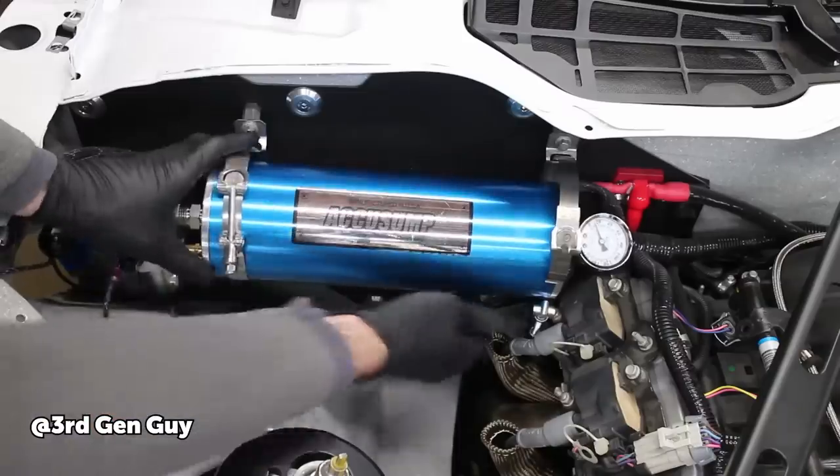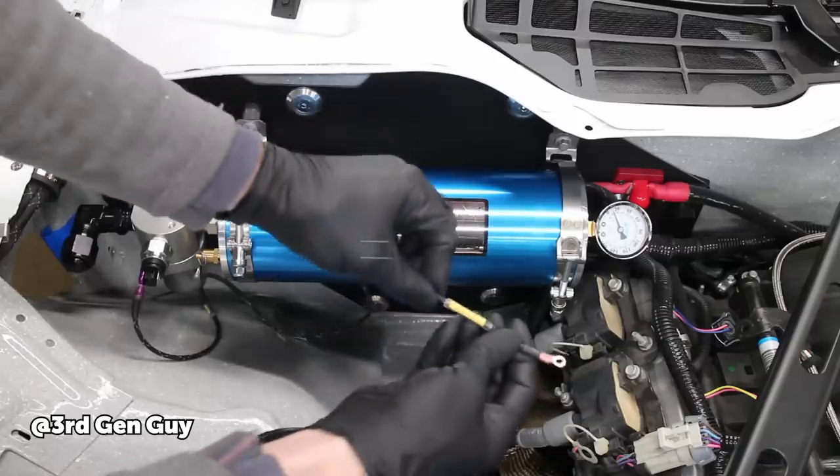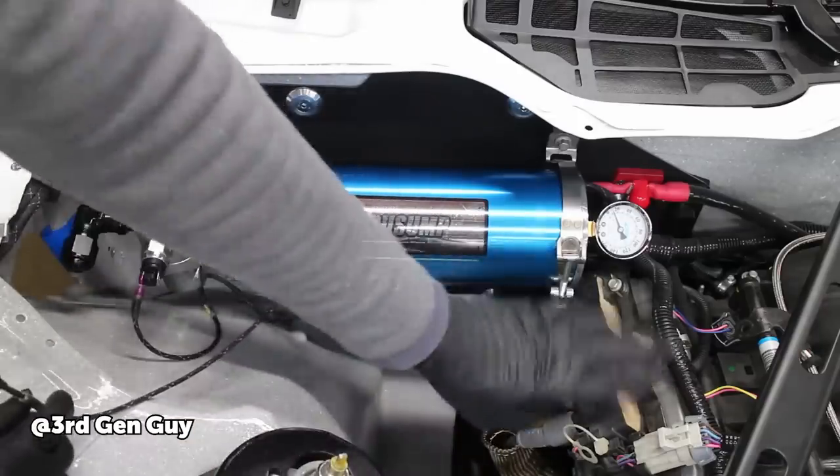This isn't necessarily a replacement for a full dry sump system, but it is literally cents on the dollar by comparison. A complete AccuSump kit — depending on individual application, whether electric or manual, different sizes, bracketing, and plumbing — would be roughly $500 to $700 USD. It's very budget-friendly and can bridge the gap between a wet sump system that isn't adequate for your application and a full dry sump, making the wet sump more than adequate for your racing or street enthusiast needs. It's not a perfect solution for everyone, but it is viable for a large number of enthusiasts.